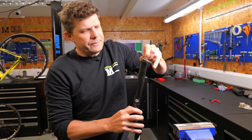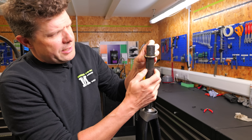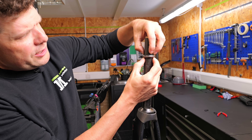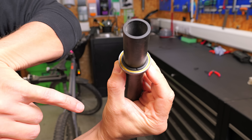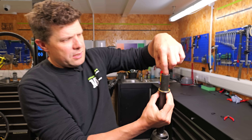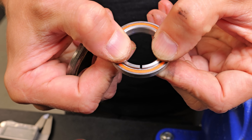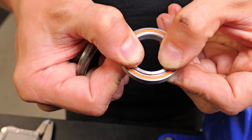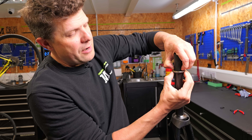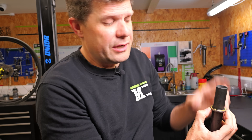This is the bearing that's come out of it — this is what should happen. That bearing should stay in your bike. The compression ring should show a little gap. What happens is you put the top cap on and tighten it down — that gap closes as it gets pushed into the bearing, and that plastic bit grips your fork so the bearing rotates. That's how things should happen.